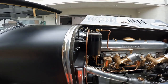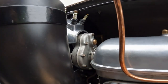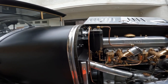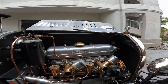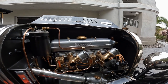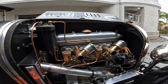What's the take-off at the back of the cylinder head? What's that device — is that for the tachometer or something? That's actually a right-angle drive for the dynamo, the generator. Oh. So that's inside — generator, and then the tach drive is inside underneath the cowl. Because it's overhead cam. See the tower drive here? Overhead cam. So this is really advanced for that age, overhead cam in production. The Europeans always had that lead. Well, the Duesenbergs were overhead cam at that age too.